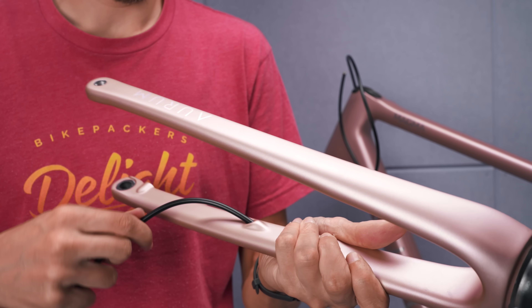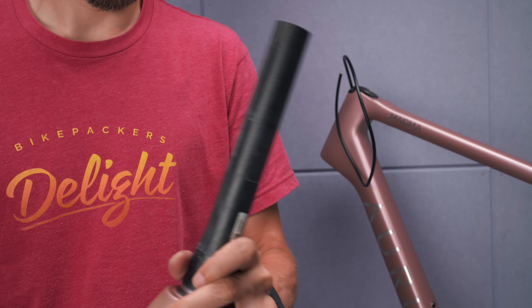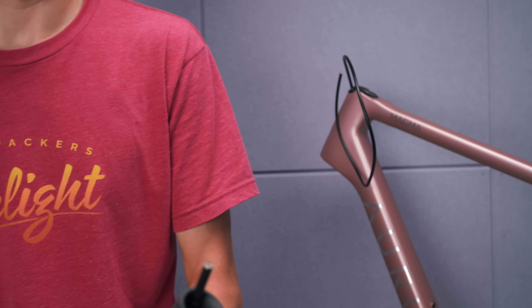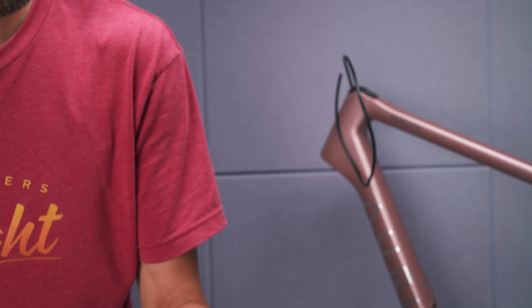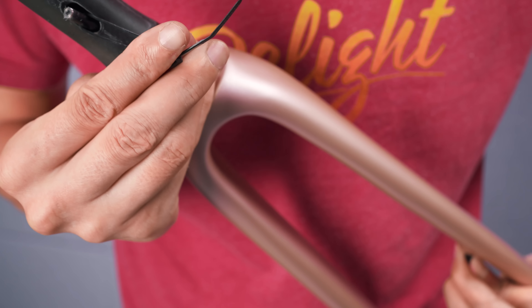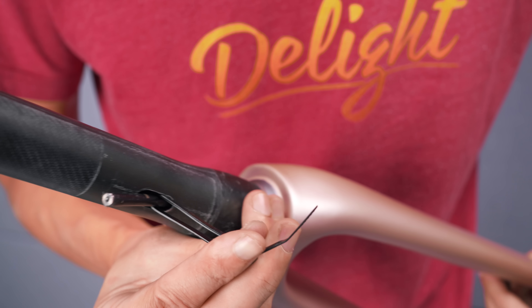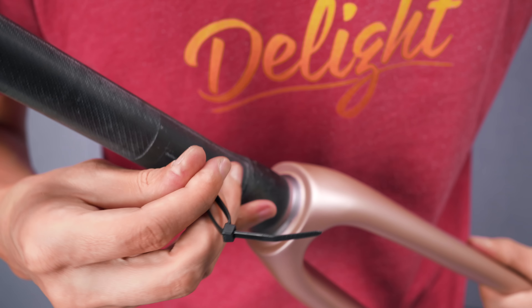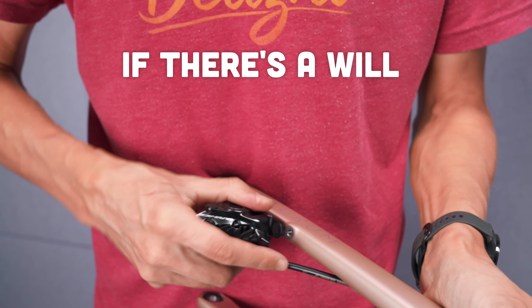The fork was a bit more fiddly, I have to say. I did not really expect a hole for the hose in the steerer. I thought it would be like my Trachamonda, where you just push the hose and it would simply pop out in the right hole — obviously not the case here. I think a hooked pick, which I didn't have, would have been the quickest way to fish the hose out. But I eventually made a tiny lasso out of a zip tie and got the hose out of that hole. If there's a will, there's a way.